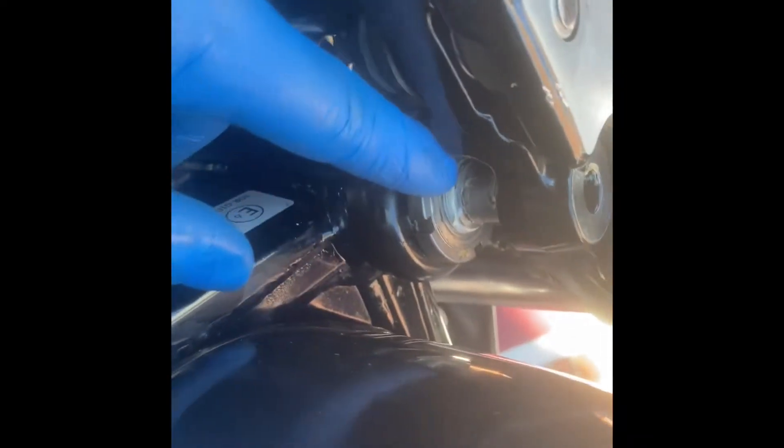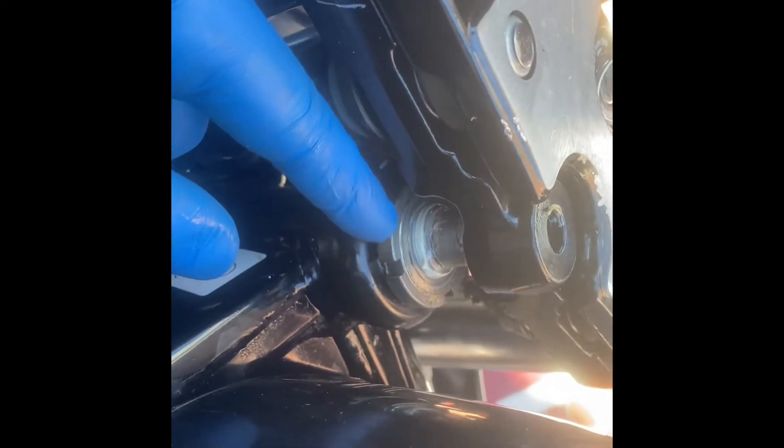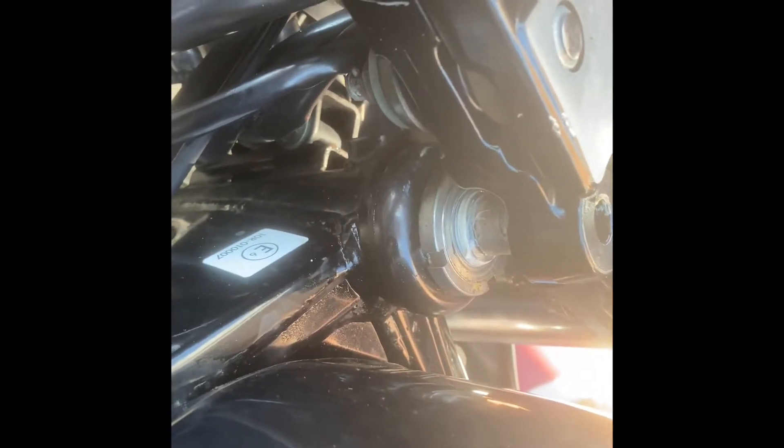The forks are back already — I did put in new seals. Now I'm about to tighten up the steering bearing a little bit. As you can see it still has white grease, which means it could still probably be from the factory itself. I am just going to tighten it a little and hopefully it is going to help get a better result on the steering. If not, then I probably have to replace the bearings.